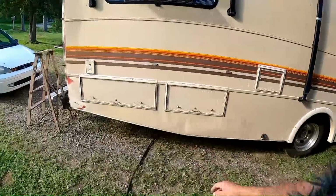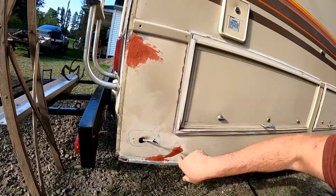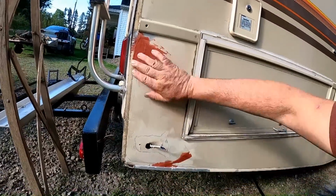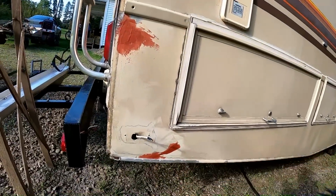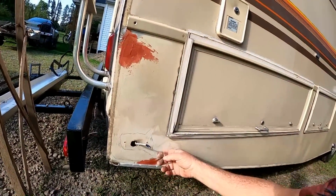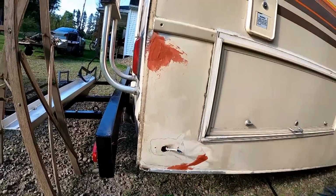Okay, this is coming along, and I don't have the perfect shade of this color to paint it, so that's hard. That's setting up right now, hardening. I did use fiberglass in there, and then sanded that and put a little bit of spot putty or glazing putty, whatever they call it, on there. So I'll have to sand that smooth, and I hate to just primer it for now. That paint I bought is a lighter color than this, and that's okay for the trim work. You know, it won't look off, but this section being lighter than the rest, it's just going to stand out. So I might paint it with that for now, but then I'm going to be looking for getting the right color and then putting another coat on this section. But that's coming along.